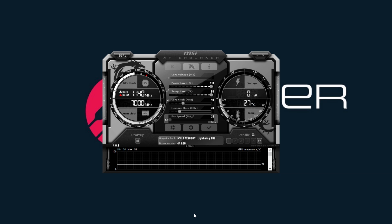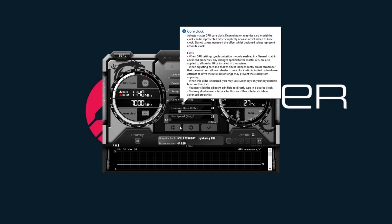We hit okay. I only do that fan curve when it's needed for overclocking, but you can apply that same profile even if you're not overclocking — your GPU will be a little bit louder than normal, but your temperatures will be lower and that will help your GPU maintain the correct core clock. So now that we have the power limit, temperature limit, and fan curve set up, we're going to mess with the core clock and the memory clock.